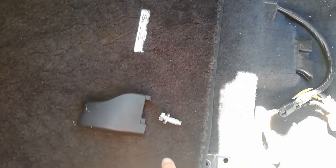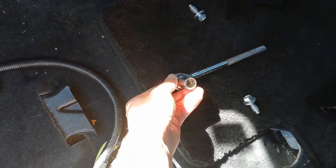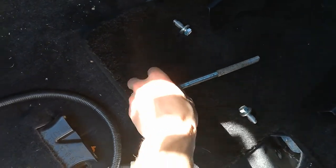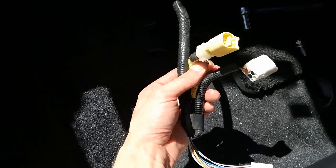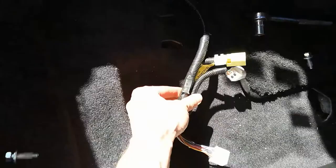The first step is to undo these four 14mm bolts. They are stuck in pretty well so you might need something bigger than a half inch — I used a half inch number 14 quality socket. Once you get the seat loose, tilt the seat back and unplug these three connector plugs. Before doing this I suggest disconnecting the battery because airbags are installed inside the seat, and disconnecting the seat plugs can potentially cause the airbag to go off.